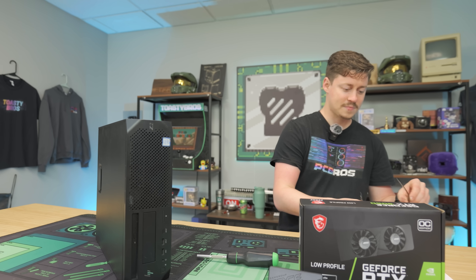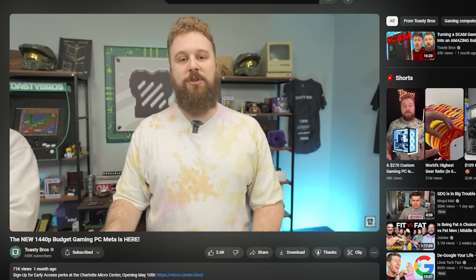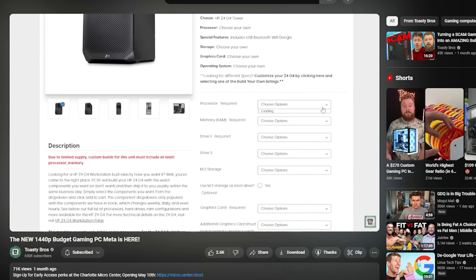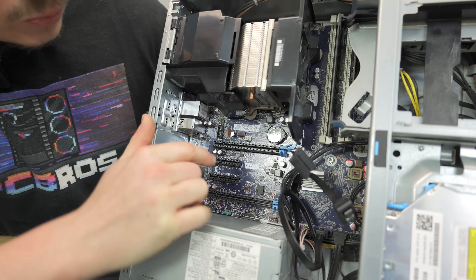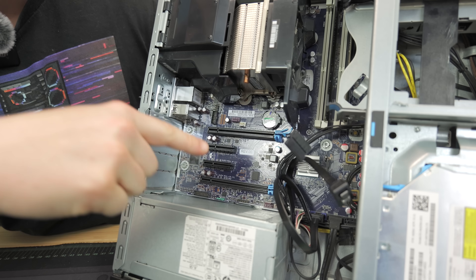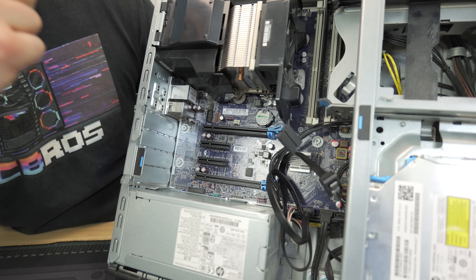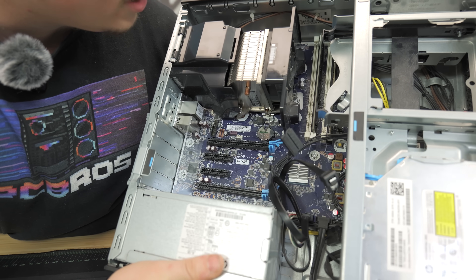All in, that's $329 for a pretty easy small form factor PC. The reason we went with these Z2s is we recently did a video on the G4 Z4s, which were the full tower workstation builds — and now they make small form factors. The biggest thing here is the reason we go with these versus the Optiplexes: we get a lot of PCIe slots, even one towards the bottom, which is normally where the PCIe is on any SFF build.